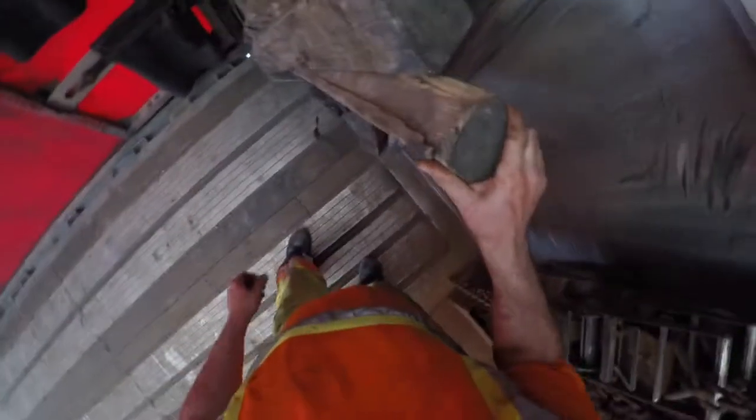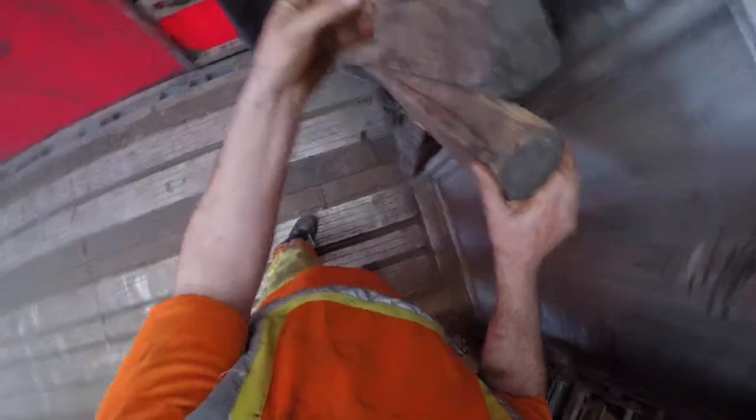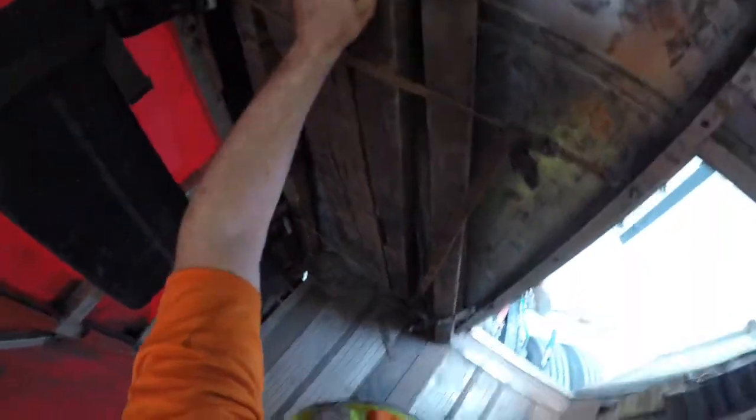Okay, so this is something people don't know — this here I'm pretty sure is not hardwood. And for these things to actually be DOT or MTO approved, the hardwood matters. What I like to do is use two of these hardwood pieces on the outside and two on the inside, so these are being supported by the rack, which keeps it legal — whereas the non-hardwood section here does kind of support the coil but isn't compliant.